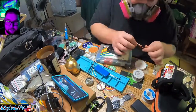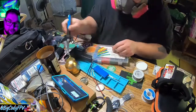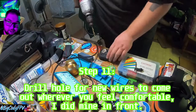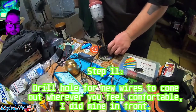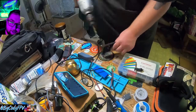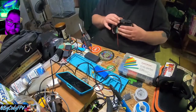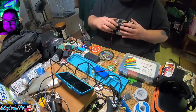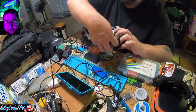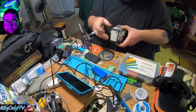Make sure you put the heat shrink tubing on before you solder everything, because after it's soldered you'll slide it up and shrink it down with a lighter or heat gun. These little battery boxes will hold any 18650 battery — just put them in. The battery box is wired like a 2S when loaded and has an on/off switch. I drilled my hole in front of the little battery icon on top of the goggles, right where the top half meets the bottom half. Then fill the gap around where the cable comes out with hot glue to keep moisture out.